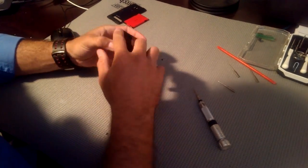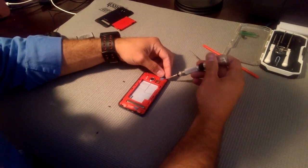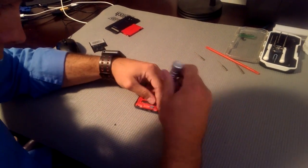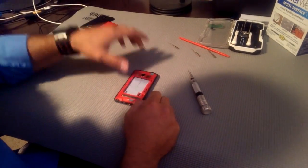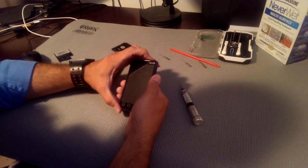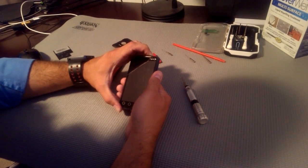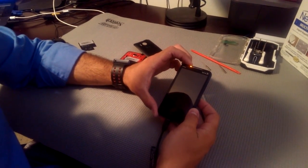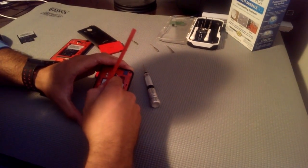You can see a white film around the edge of the phone. Coating the entire phone — screen and everything — would not be an option with the way this spray stuff dries. Once I reassembled the phone, nothing. The phone appears to turn on — it vibrates, lights up, and charges — but the screen is dead. The sprays must have somehow come in contact with the LCD and digitizer ribbon cables and shorted it out. I tried scraping off the battery connectors as well to see if that does anything, but nothing.